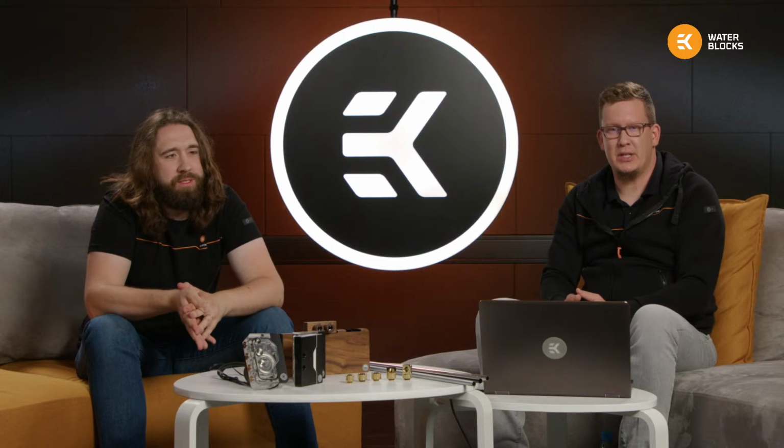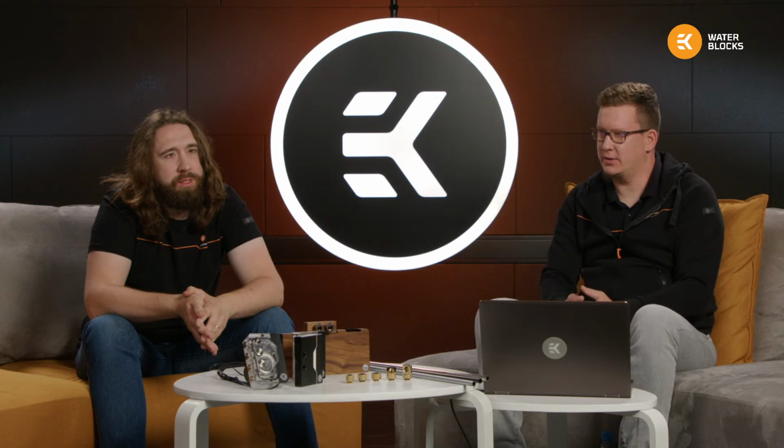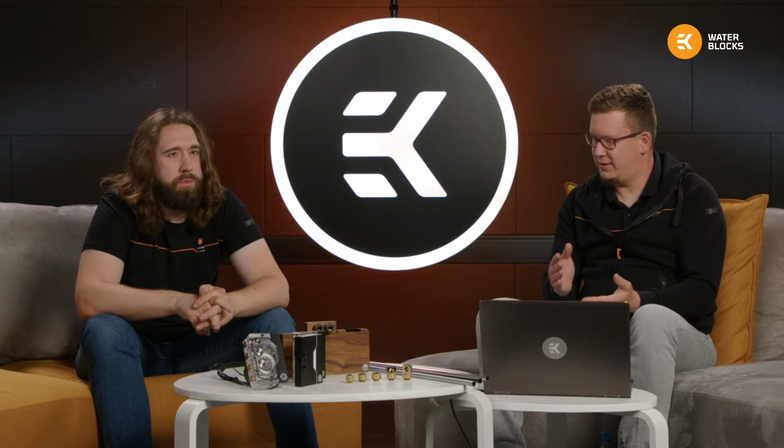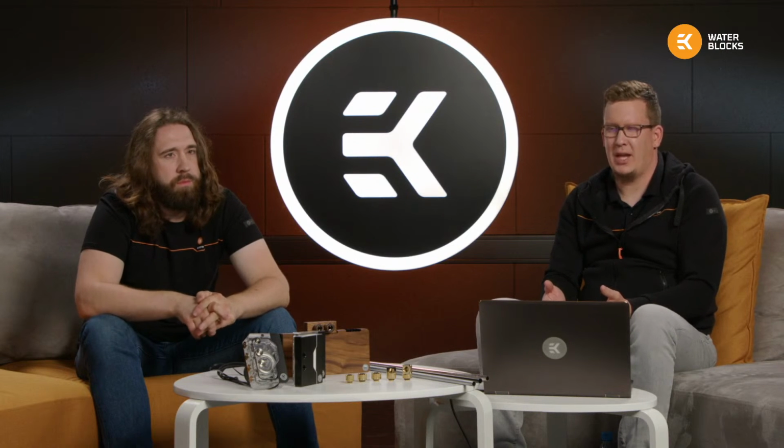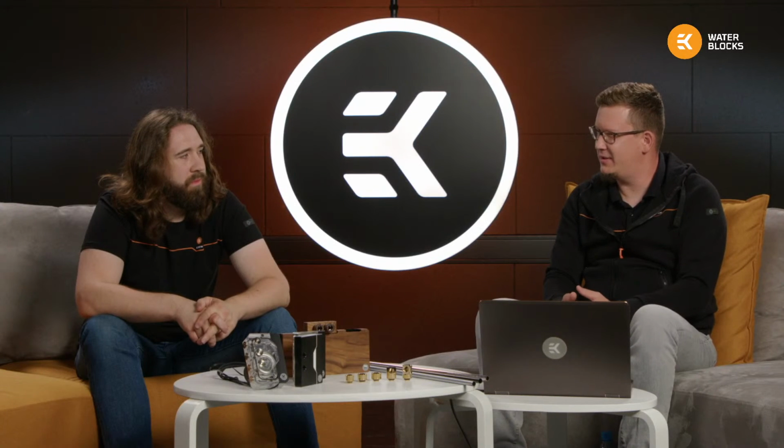One more question from Pascal. He asked, why did we stop making full board monoblocks? Well, we didn't actually stop making them. We just did one for Asus. It's not a monoblock, it's an ultra block, as we like to call it, because it is cooling the CPU, the VRM. It is also cooling the M.2 slot. It's also cooling the chipset, and it has a screen. It has a flow meter. It has a temperature sensor. And did I miss anything? And the leak sensors. Leak sensor, yeah.